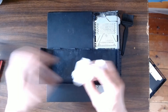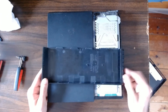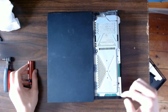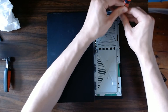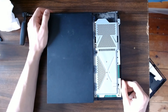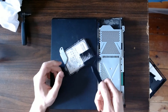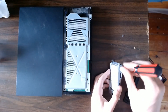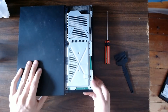Just real quick, we want to wipe out this part again, same as the bottom cover. After you finish brushing or using a napkin to clean this part, you can move on to the next step. We're going to remove all the screws you see here — seven in total — all Torx except for one Phillips, which holds the hard drive. Go ahead and slide out the hard drive. Now clean out the hard drive using canned air, a brush, and a napkin as you see fit. For a deep cleaning, remove the hard drive from its bay and clean it off even more with the brush. Now that the hard drive's been cleaned, put it aside and flip over the console again.